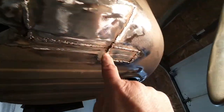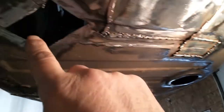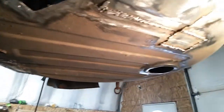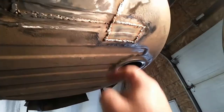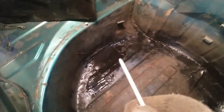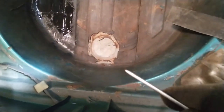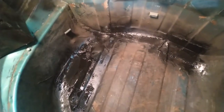Here we are - cut and paste day. So I got this piece in, grinded it down, got that little piece in there, and this one here next. They actually go along pretty quick and then that one there I'll get last. I'll leave that for a while, grind it, then go hunting for pinholes after I get them all done. There it is - there's a patch there, a patch there, a patch over here, and a patch over here - all done. This one here I'm still thinking about what to do - there's a hole right there but I've got a rubber plug for that somewhere I hope.